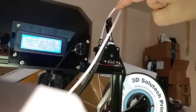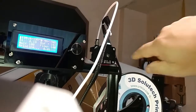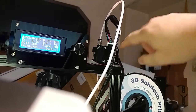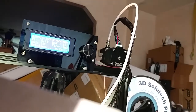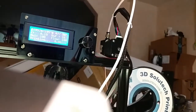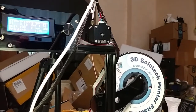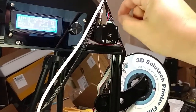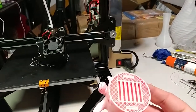That wasn't the problem — that was just a symptom of the problem. The problem was the grub screw loosening up, and the slightly increased pressure in the tube when it was at an acute angle caused it to slip sooner. When I relieved the pressure, it relieved a little bit of the pressure that was causing it to slip. But this is the actual problem — the loose grub screw was still there. And so overnight as it printed, that grub screw got looser and looser and looser until it stopped extruding and failed.